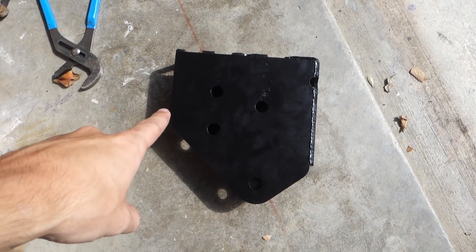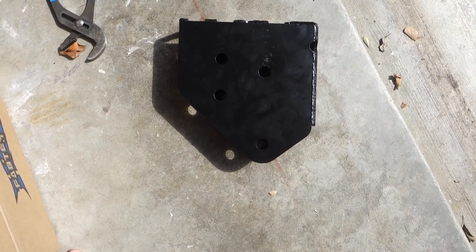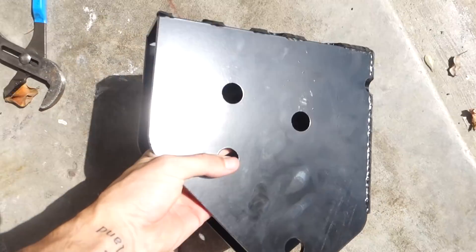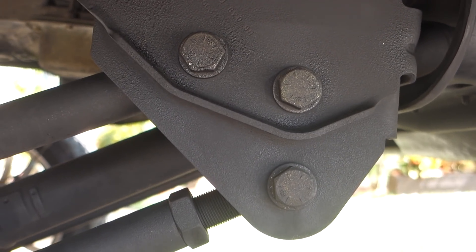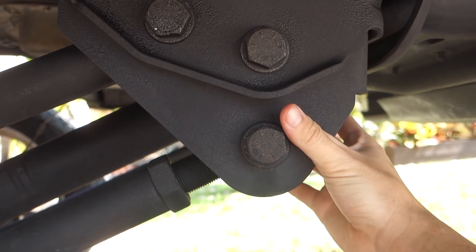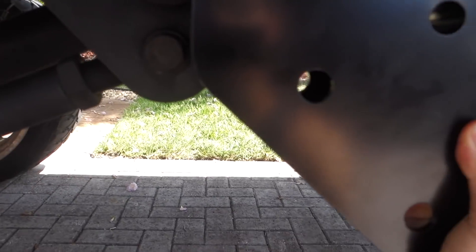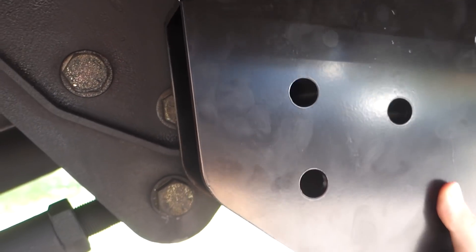I got some new pieces. These are four-link drop brackets, which should drop my four-link arms enough to push my front axle back out and correct the caster, which in theory will also correct the death wobble — but we don't know yet. Look at this bad boy. This thing's so heavy — that's how you know it's good quality. Fab Tech. This is the old one, really small. If you have an 8-inch lift, which this kit was, then it works really well. But I don't have an 8-inch lift anymore, so we got this. It's a lot bigger.